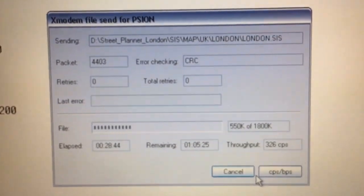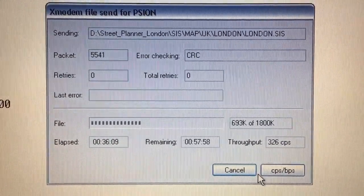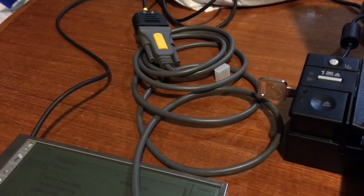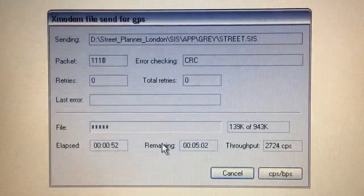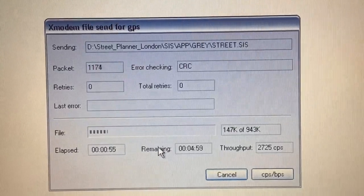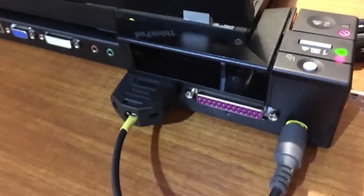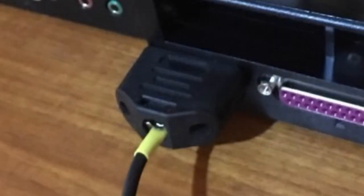We're up to one of the loose ends left in the previous telephony video, where I showed a back-to-back modem connection but no actual file transfer because I knew I'd be doing one anyway. So here it is — one way to install the GPS program is to copy over five or so installation files, the first two of which I transferred using a modem back-to-back, then switched to a null modem cable because the modems are slower. In addition to the USB to serial converter I also got a laptop dock that includes an RS232 serial port, and that went fine too with a very plain wired null modem cable.